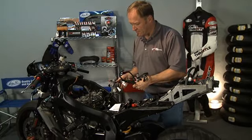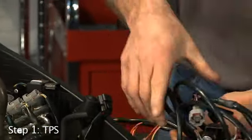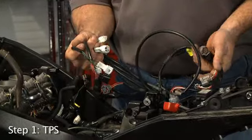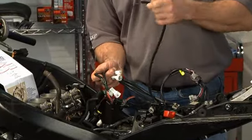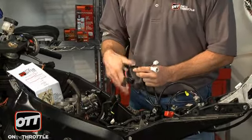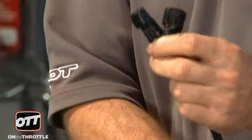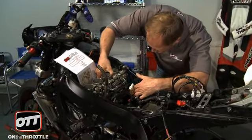We have all kinds of different things here which will plug in. There's four in a line here that has to be fuel injection. Here are some where they're singles. Here is another four in a line which is fuel injection. This will be mounted to the engine as a ground. These are not black, nor are these — that means this must be your throttle position sensor.